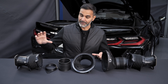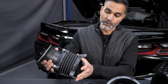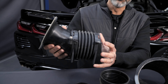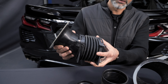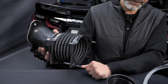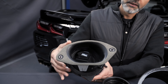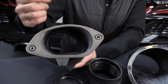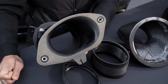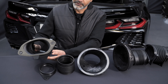The first thing is the actual inlet ducts. On the stock system you have this plastic inlet duct section which secures to the side panels where the openings are. The airflow then moves into this rubber flexible section, which allows the airbox to move with the engine, and then this directly bolts onto the central airbox. The inside of those stock plastic inlets is actually pretty good — it's a nice smooth curve where it goes from that irregular oval type shape down to the airbox, which is a more regular oval on the inlet of the filter.